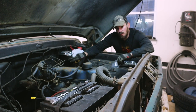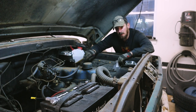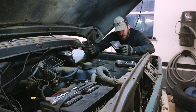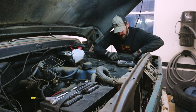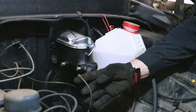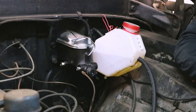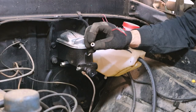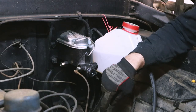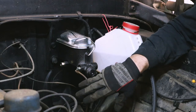The next thing I'm going to do is start installing these brake lines from the master cylinder down to the proportional valve. I haven't installed the proportional valve yet, but I'm going to mount it down on the frame rail and then go from the proportional valve to each brake. I ordered a bunch of fittings off Amazon for 3/16" line because this master cylinder uses a different size than what came on the truck. The original line and fittings from the '66 brake system were 3/16", and the master cylinder now has correct fittings for 3/16" line.